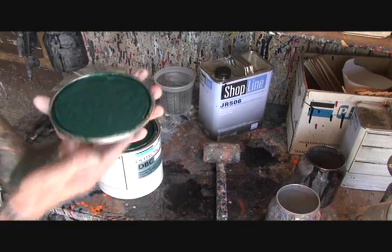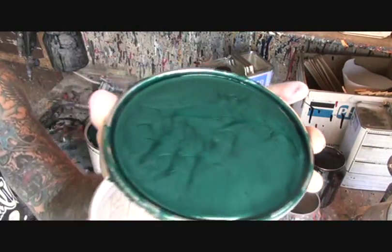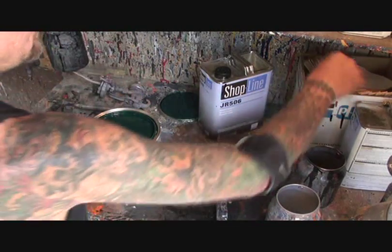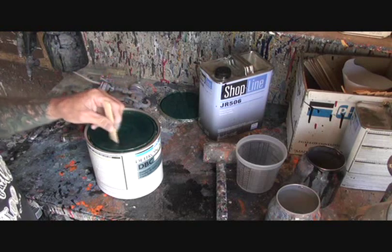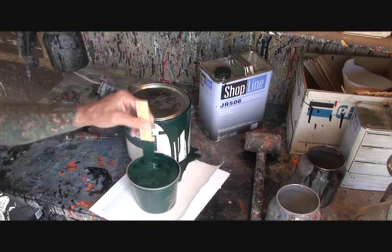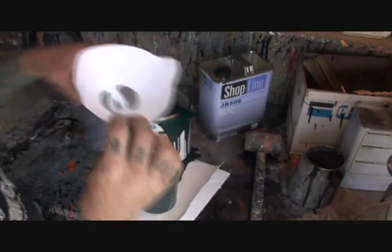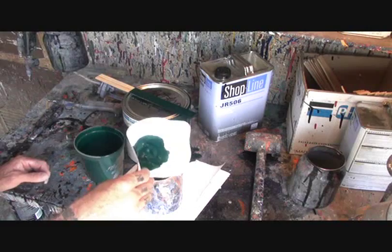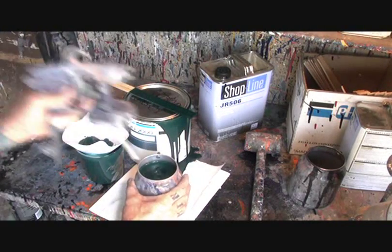There's a little dot — a little green dot. If you look at it, there's our green 1955 Buick custom color that we're going to be using. The customer did want to get a full gallon of that so he can have extra, in case he has to paint something else, because he owns several of these cars. You should paint thoroughly, and always use a strainer on your paint. You can see micro-fine little pieces of trash that were in the paint, and that will actually go through the gun and splatter on your paint job — that's something we don't want.